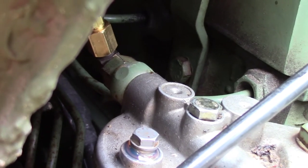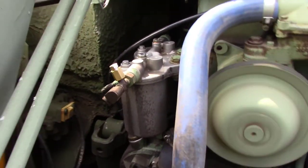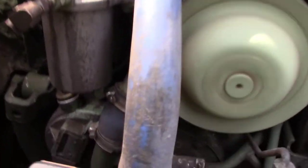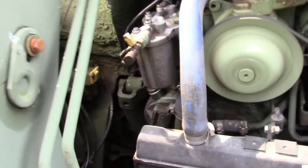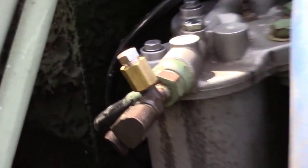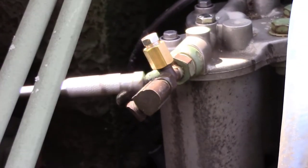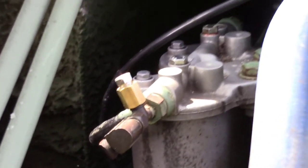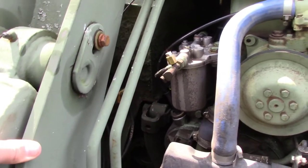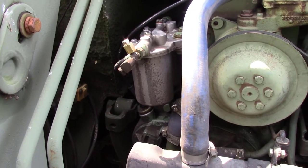We'll bleed the rear one. The other one is straight fuel, nothing else. Here is the plug and the brake union on the fuel system. There are no leaks. We've run it around the property a couple times just to verify that nothing's going to vibrate loose. Good fix — it primed up quick, and the mog started right up.